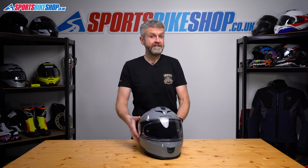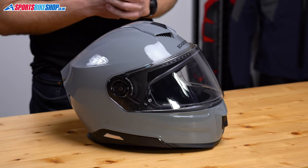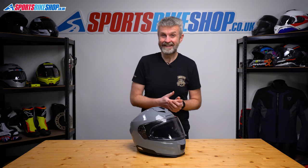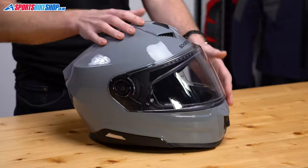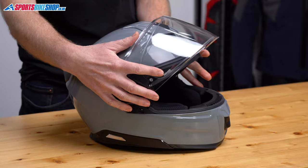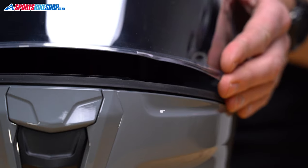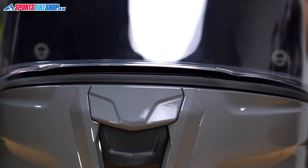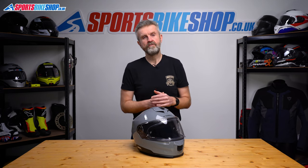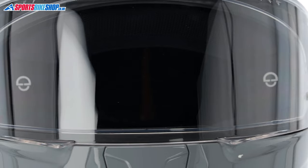The visor for this helmet is exactly the same as the one that's used on the C5. It's dead easy to change. There's a link in the description for this video that will take you to our guide on how to change it. There are five intermediate stages between open and closed, and the lowest of those puts the visor in the city or cracked position. This leaves a 10mm gap between the visor lip and the seal, which I found ideal for letting in some air when I was riding at lower speed.